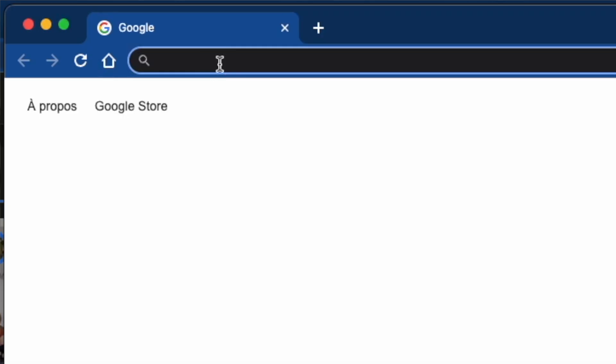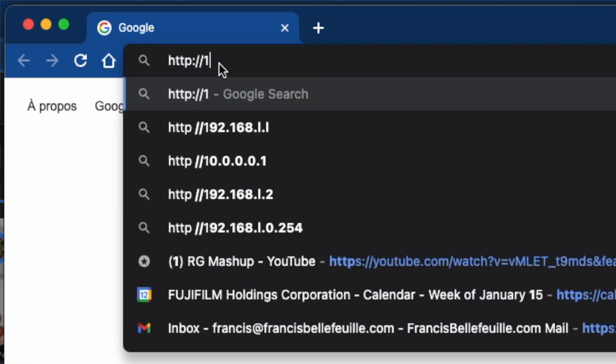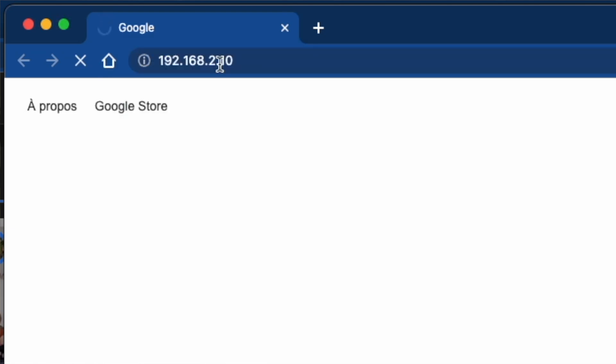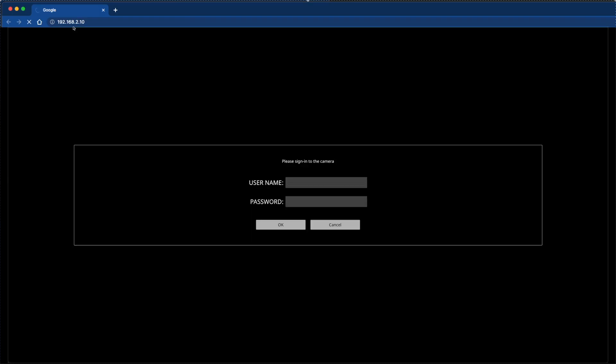Press OK to exit the screen. Using a PC or device connected to the same access point, open a browser window and click on the address bar. Type the following: HTTP colon slash slash followed by the IP address of the file transmitter grip. For the complete browser and OS compatibility chart, please use the link in the description of this video.